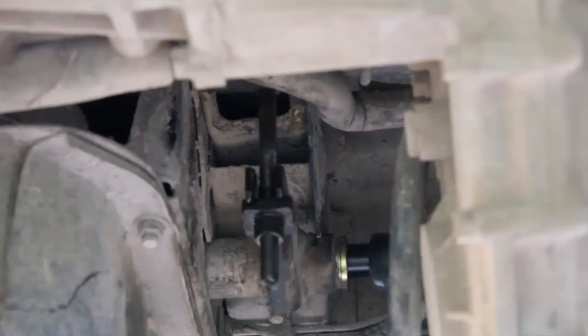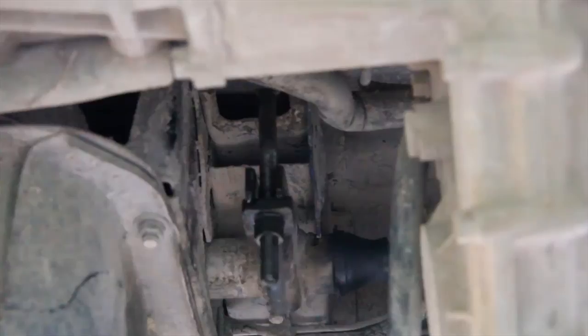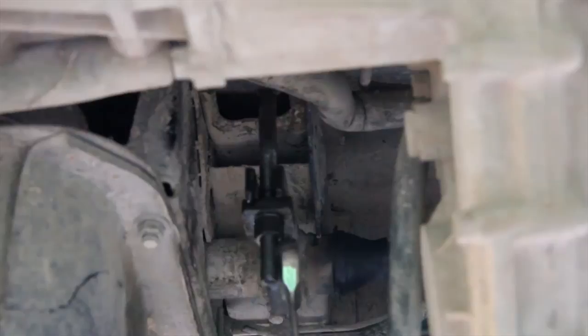That's pretty much parallel with the petrol tank. I'm going to put these rubber grommet sleeves back on to keep the rubbish out. I'm going to leave the locking nut off and do the driver side the same before I lower it down. So what I've done is re-index both torsion bars and put the nut on so that the adjustment arms are roughly parallel to the frame.